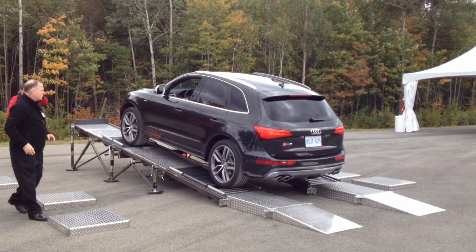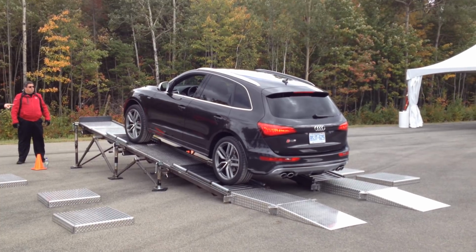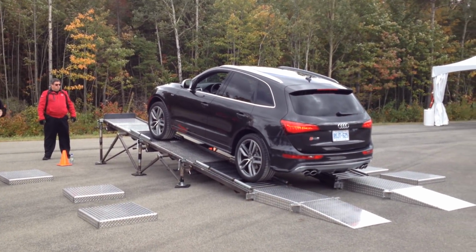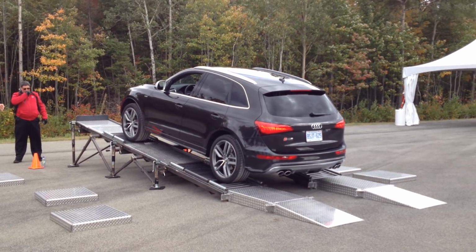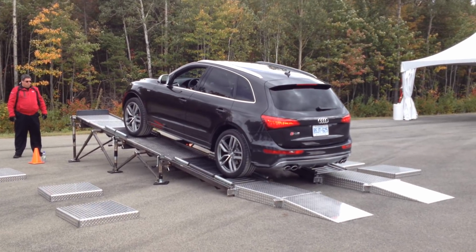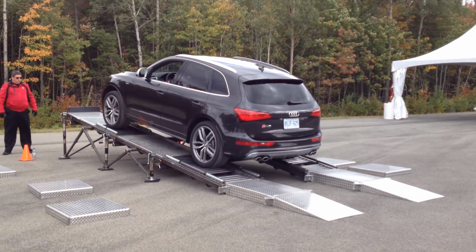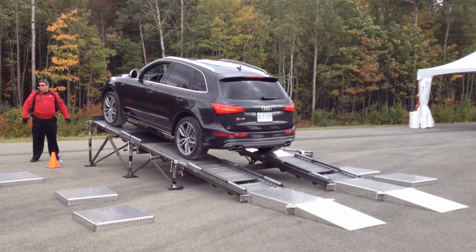Okay. So now in theory, the rears are really going to spin just like before. But now we've got a liability here where the diff in front is an open differential. There are no clutch packs there, so it's going to be EDL on either side that determines where the torque goes. Go ahead. One tire's got grip.